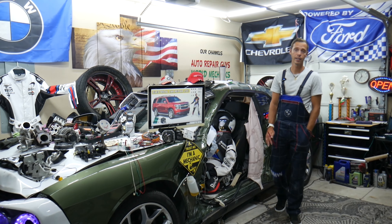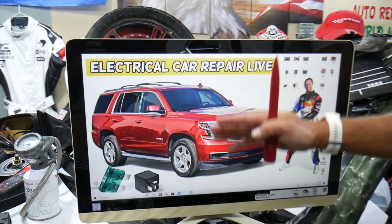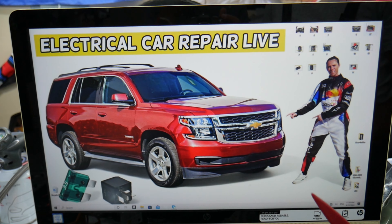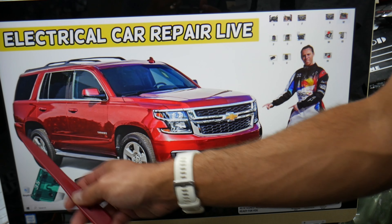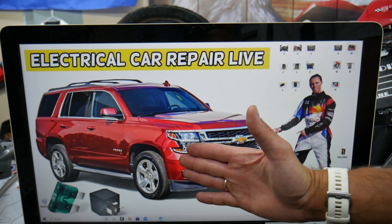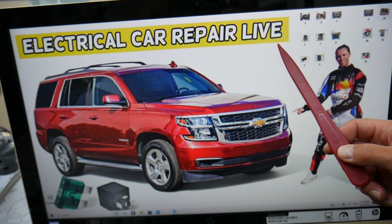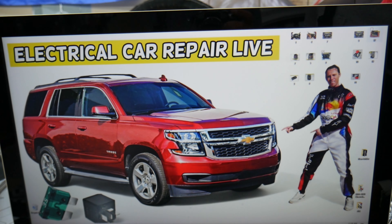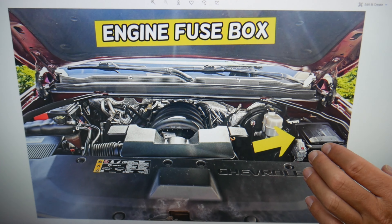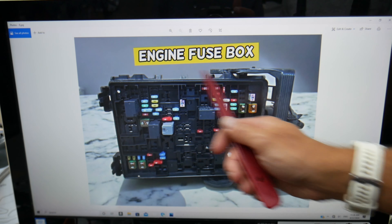So guys, if one of the headlights is out and not working, what can cause that? Multiple things, but the first thing you always want to check is your fuses — especially if you replaced the bulb and it still doesn't work. Always check your fuses; it could be a very simple fix. This applies to both Chevy Tahoe and Chevy Suburban, as both vehicles are built on the same platform. Quick reminder: 9 out of 10 people do not know that there are up to 5 different fuse boxes in that SUV. We made a special video called 'Chevy Tahoe/Chevy Suburban Fuse Box Location and Diagram.' Go ahead and open the hood. Facing the engine on the right side on the driver's side, you have a fuse box — open that cover and you'll find a fuse box with a layout like this one here.